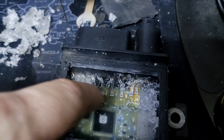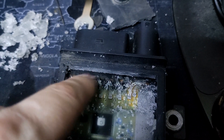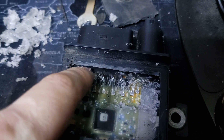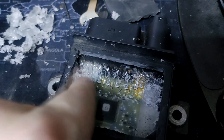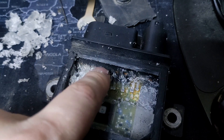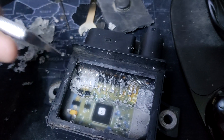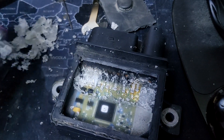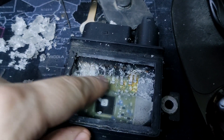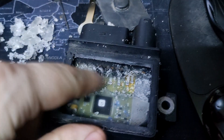Basically what happens is these wires break or lose connection, and that's what causes your glow plug module to fail. So you have to scrape all these pads until you see copper. The pins from this piece here are under here — you need to scrape them as well. Most of this I just got out with my finger. I'm going to have to get in between things and for that I'm going to use one of these to get right into the edge. I'd suggest using a plastic tool if you have one, because it's less likely to damage stuff.